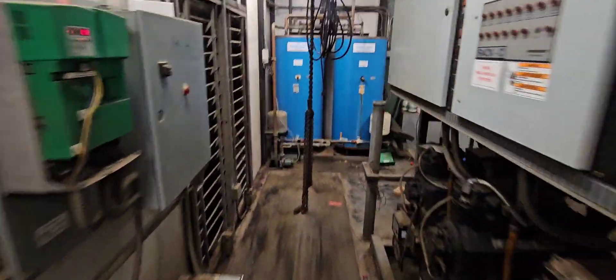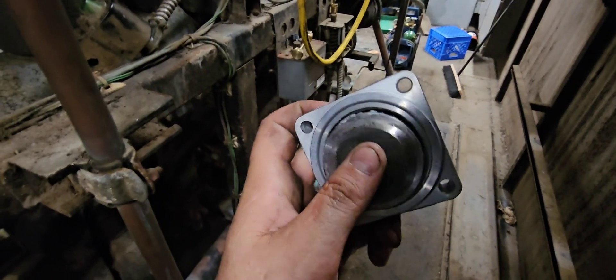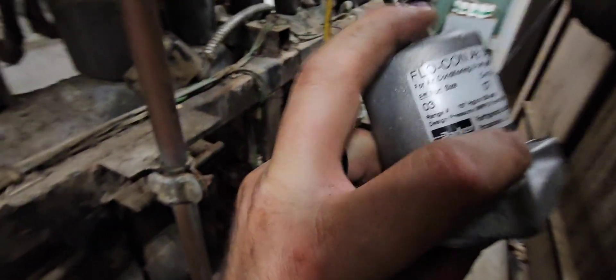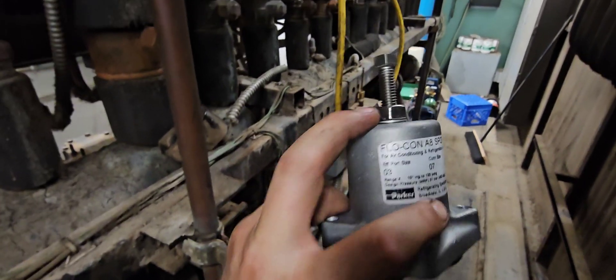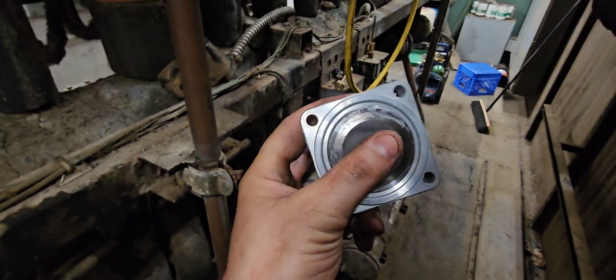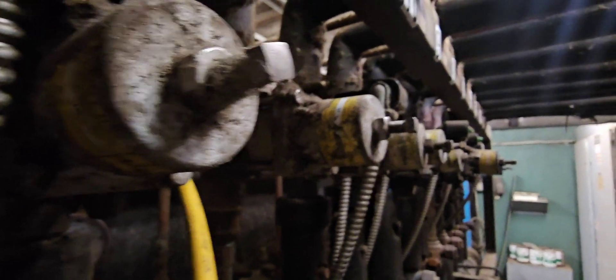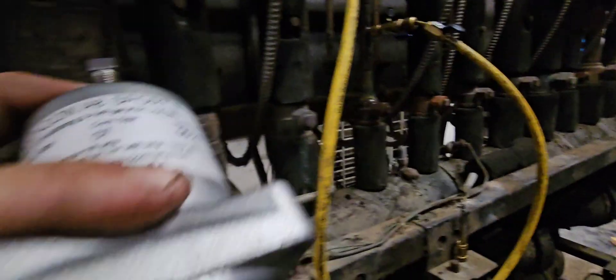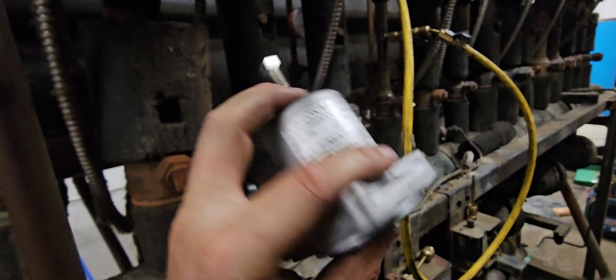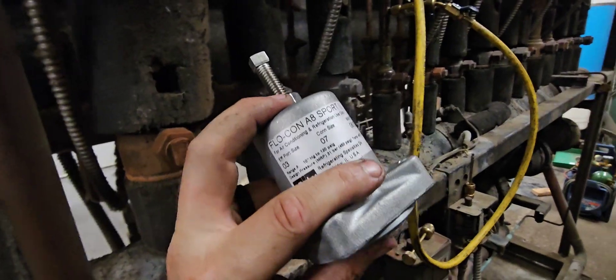Pro tip: see how that disc is sticking out a little bit? It's going to fight against me when I try to put it on. What I'm going to do is take this stem all the way out — that's going to make this thing not want to fight against me while putting it in. Same thing up here — take that stem all the way out so it's not trying to push against me while I'm taking those bolts out. It makes replacing these a lot easier so you're not fighting the force of that spring.